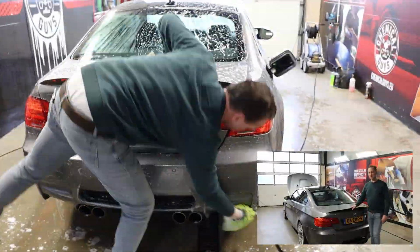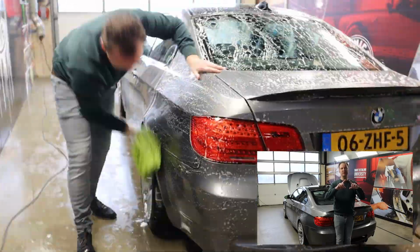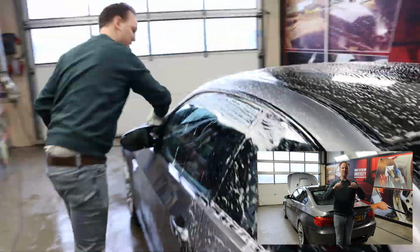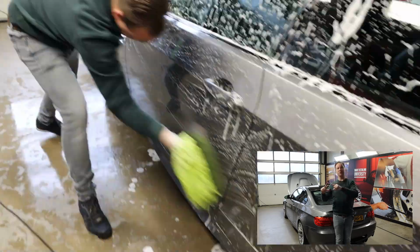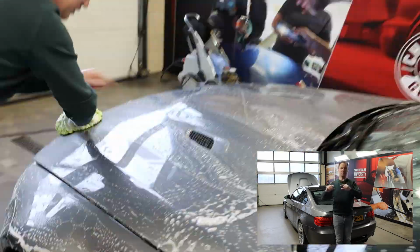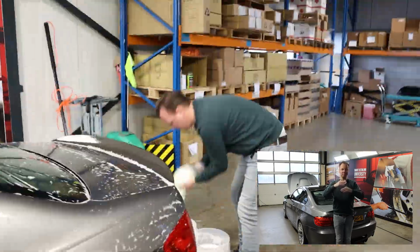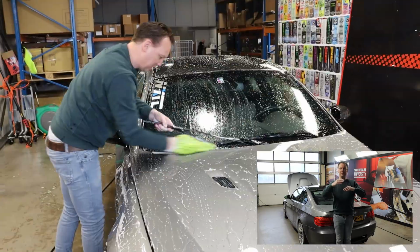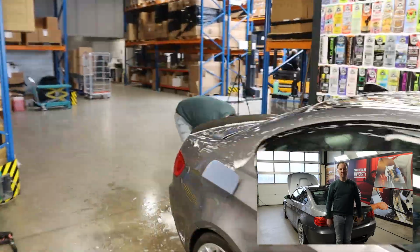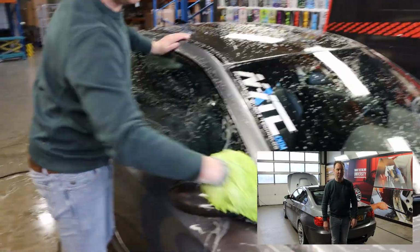So where does polishing dust come from? In a polishing cream or paste, there is an abrasive on a certain grit scale, and with rubbing, the abrasive in the paste breaks down and gets smaller and smaller and smaller. From that grit scale becoming smaller, aluminium oxide, for example, which is one of the raw materials, the remains of the broken down abrasive need to go somewhere. In this case, it is polishing dust on the rear window of my BMW.